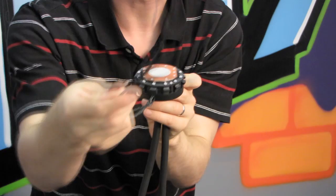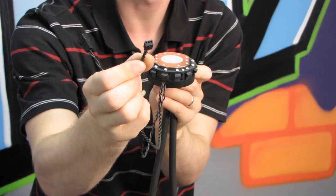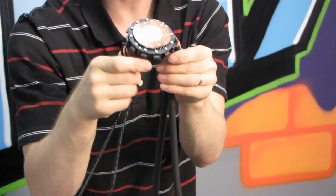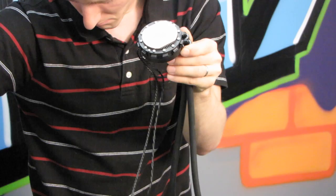There are two cables coming out of the pump: one is for power to the pump — a standard 3-pin power connector — and the other is an output for power to the fan. This allows the cooler software to intelligently control the pump and the fan according to liquid temperatures.